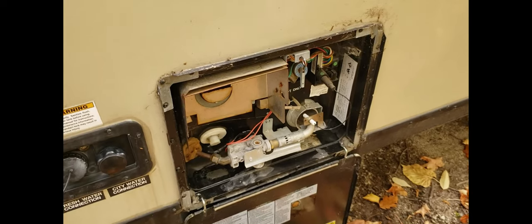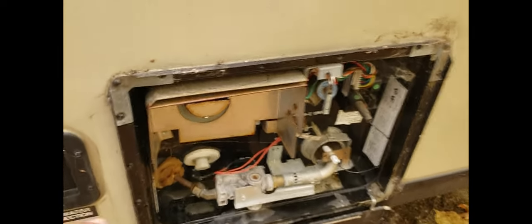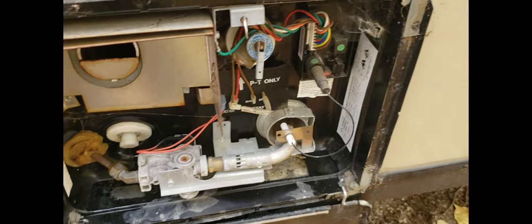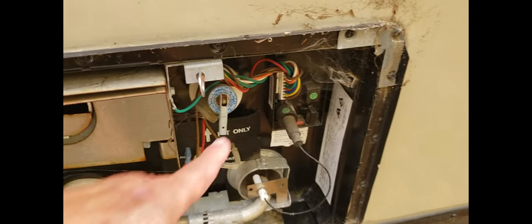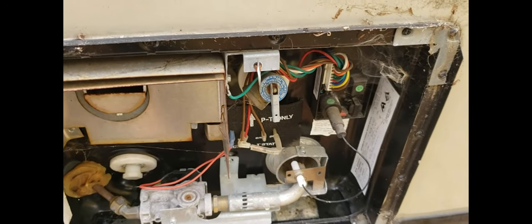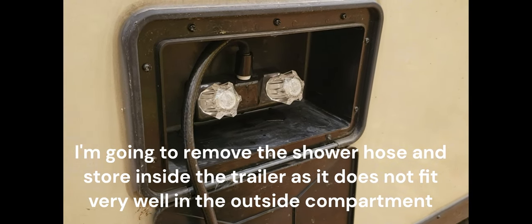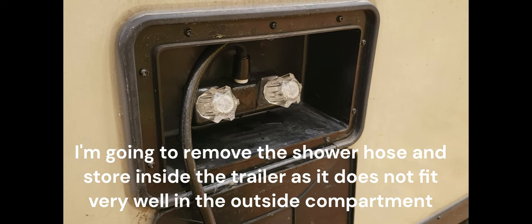With the regular water line back in place, I can now go outside and finish up out there. I put the plug back on the hot water tank just a half turn or a couple of turns, just to keep things from going in there like bees or whatever. I close the little air vent valve. I'm also going to remove the outside shower hose and store it inside the RV. There are two low-point water drain plugs — I'm going to remove those for the winter and put them in the water heater compartment for safekeeping.